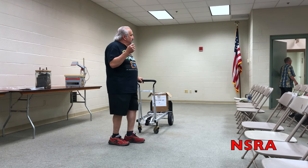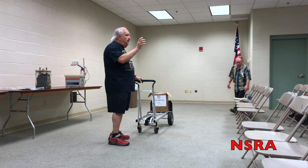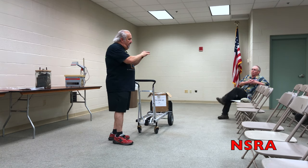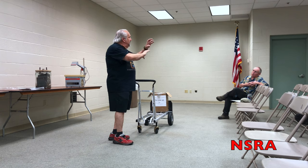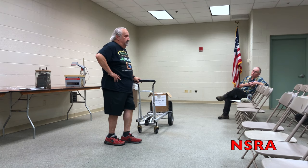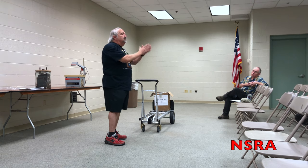And the reason they were made for emergency lights and medical equipment is those batteries sit around a long time, and they don't move. And 20 years ago, the battery chargers were very simple trickle chargers. When I was mentioning that batteries stratify, that the water goes to the top and the sulfuric acid goes to the bottom, well, those batteries, using lead acid, would separate, so you'd have to change the batteries out every 3 to 6 months. Well, they wanted something better, so they came out with, the original word for it was gel battery. AGM batteries, you know, are the same thing. It's just how they go about holding the sulfuric acid and the water together so they don't separate.